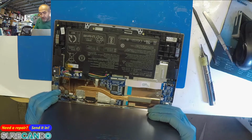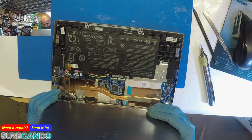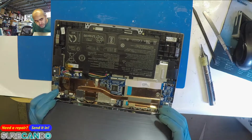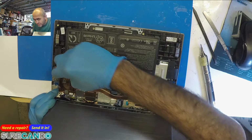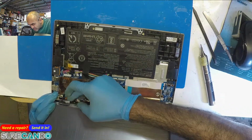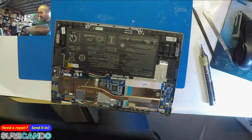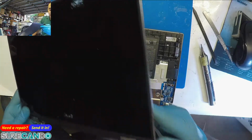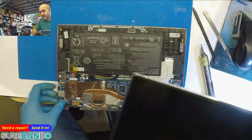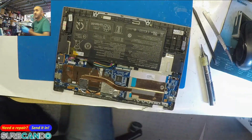Now this one, the motherboard BIOS gets reset when this happens. So not even a backlight indicates potentially the screen is maybe fine. Could be a simple case of the LCD backlight, or maybe the cable for the LCD. So just to make sure that it could be that, I just don't see any physical damage.